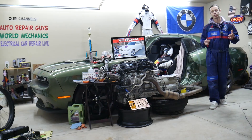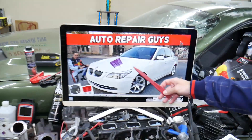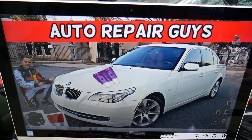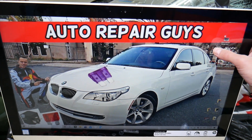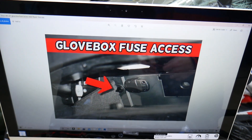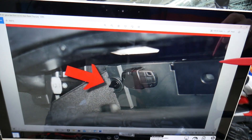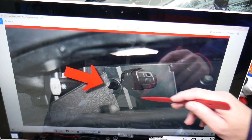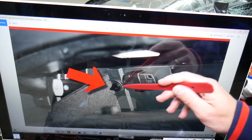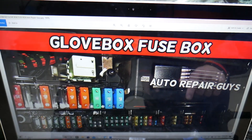So the TCU fuses, also known as Telematics fuses — where are they located? Let's explain that now on a 2008 BMW 5 Series. You have three different fuse boxes and today we work in two of them. The first fuse box: open the glove box, and on the back side — if you empty the whole content of your glove box — you remove that cover by turning those turning knobs 90 degrees, one on the left and one on the right side, and behind it you'll get to a fuse box.